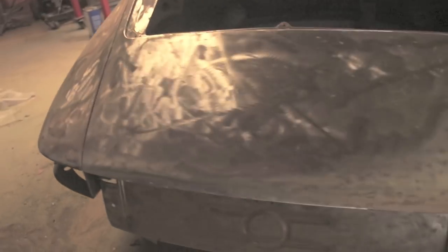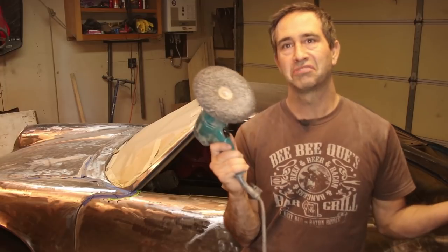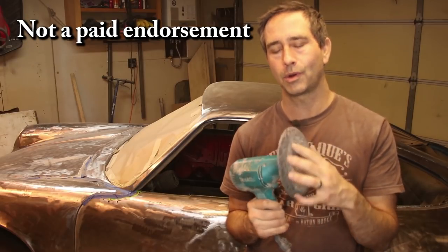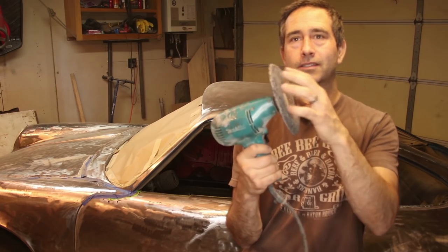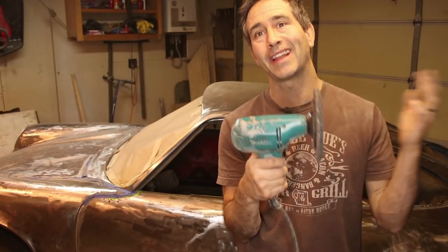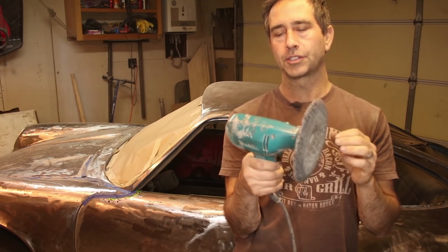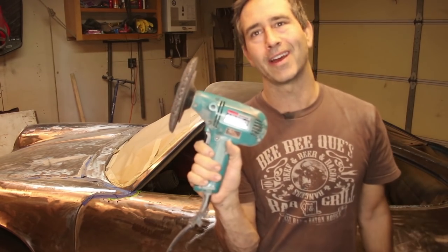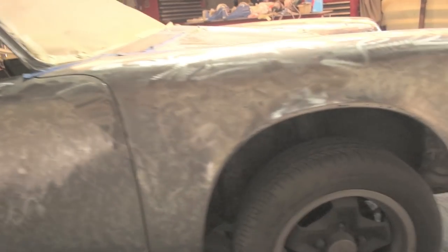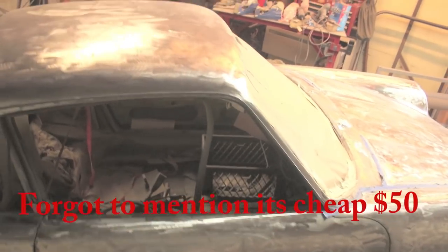In summary, I think it took about six hours. I was letting the stripper work while I was hitting the other side with the strip-it disc. Here's the strip-it disc - it's still in good shape. I love these things. They don't clog up like sandpaper does. It's very coarse, almost like a coral. The diameter didn't change that much. I've been using this thing for years. There's a link in the description below if you want to check this out. The sander is key - this is a Makita GV5000. There are tons of ways to strip a car; every method has a disadvantage. This is kind of what I like to do. It takes a long time, but it also takes a long time to transport the car to a sand blaster or something.